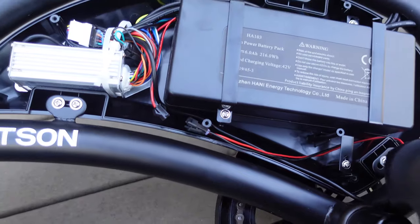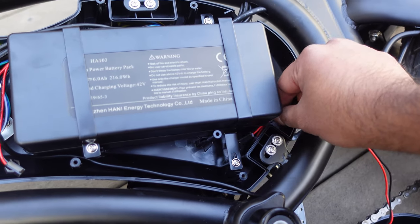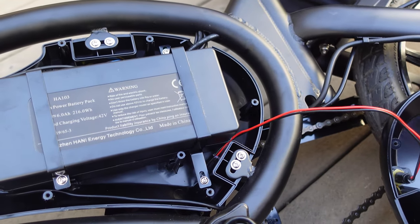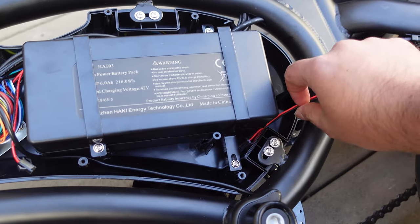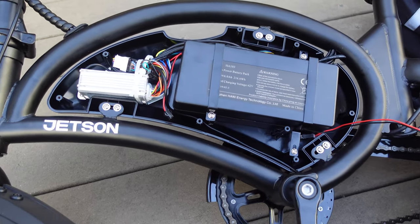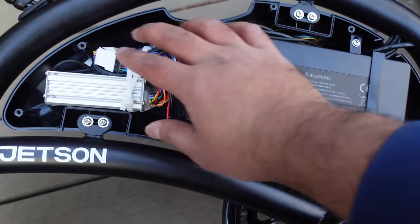Be very careful removing the cap because there is a charging port cable connected to it. Be very gentle. There's the cable — let's disconnect it from the charge port. There's a little tab right here, so push on that tab and then pull, and it detaches. The cable gets stuck right here, so I'm going to keep the cap close rather than fully removing it until we take out the battery.